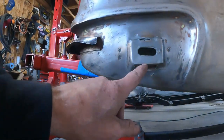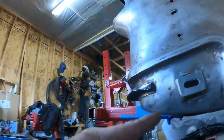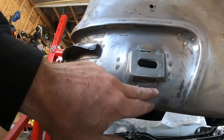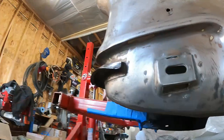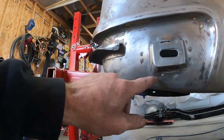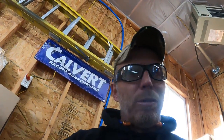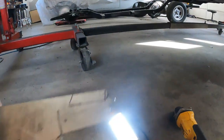As a general rule, I've always been told when you're making patch panels you always want to round the corners — it has to do with how the heat's going to shrink the metal and pull it. If it's a 90 degree corner it causes more issues. I'm no expert, that's just what I've read and seen from other people. In this case I got squared off corners, but I'm not going to worry about it too much on this little patch — it's all hidden by the bumper. It's going to get buzzed in, ground down, and a little bit of fill to make it less obvious.